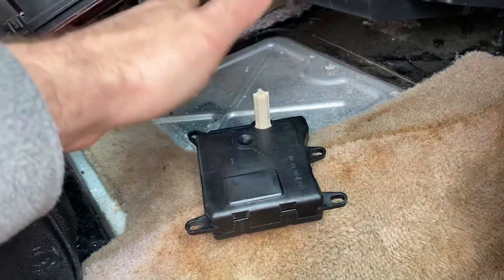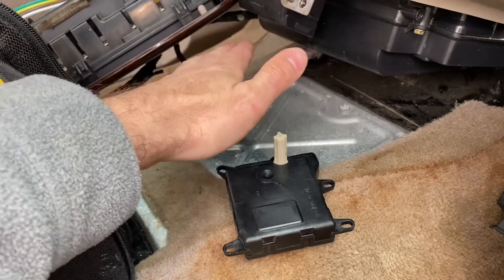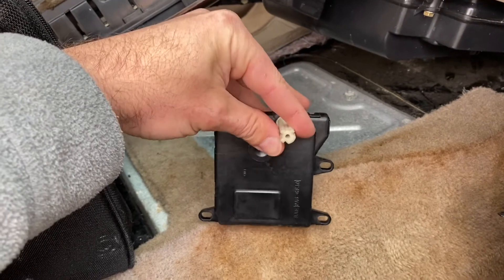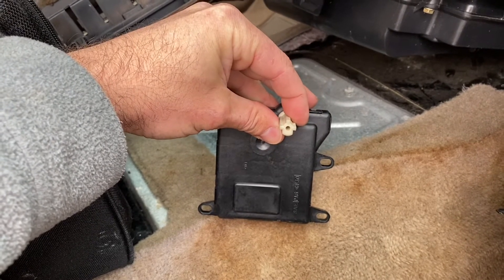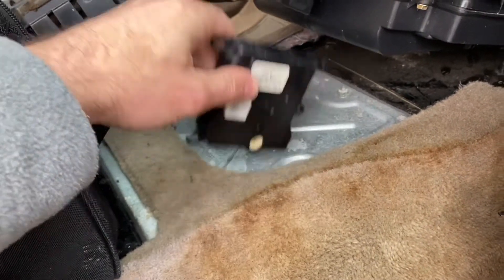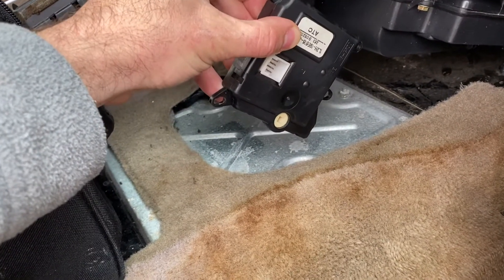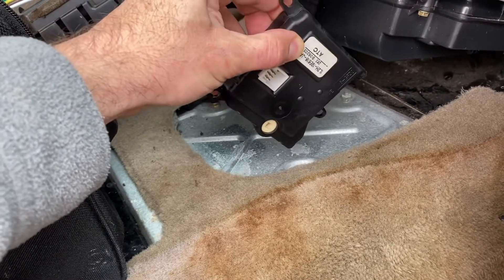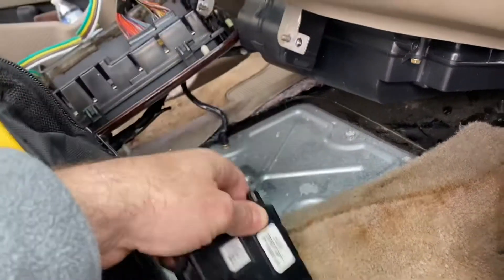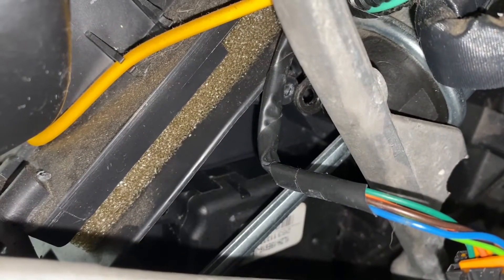The female portion will swivel because it's hooked up to the blend door, so it'll move down there. The new unit - this piece is rigid. On the old one it's broken so it moves easily. It came like this straight up and down, so when I slipped it in, I had to go in like this, work it behind the rod, then kind of grab the corner of that female piece and twist it around and shove it in. It was pretty tough to do, but I'd say it took me about 10 minutes to figure that out.